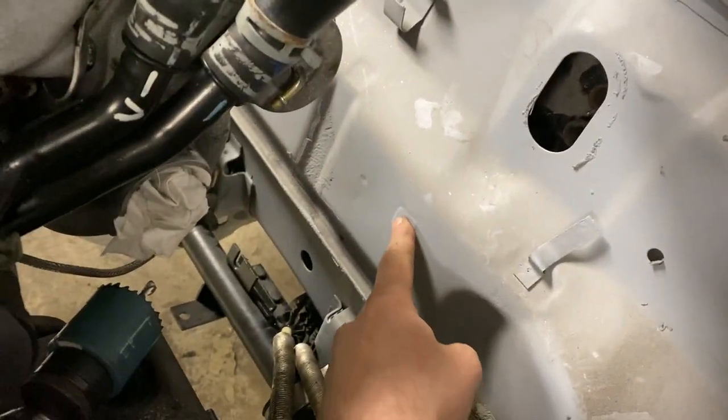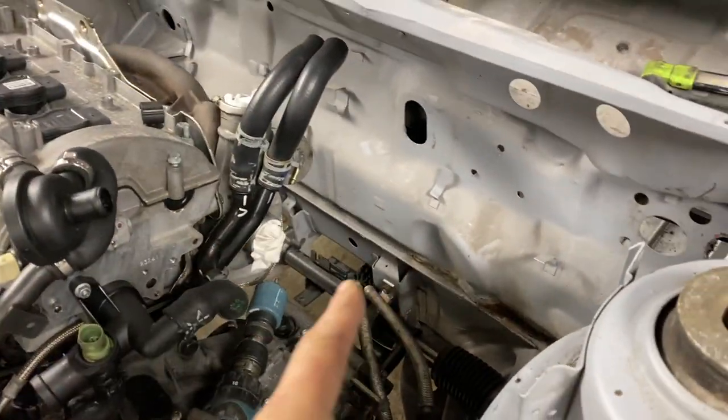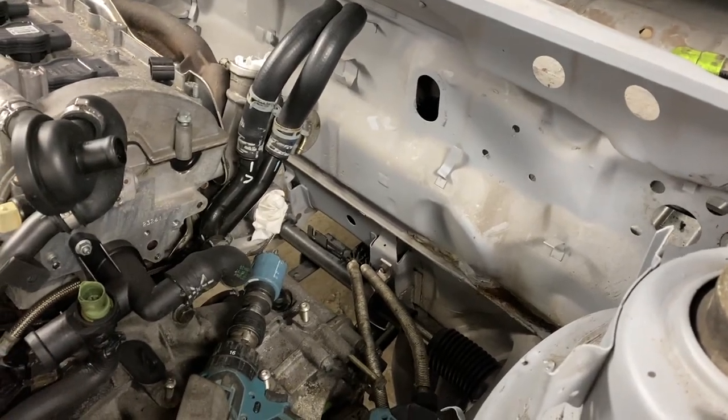That little indent there is that cable clip, if you see it on the bulkhead there. So we don't need to worry about getting rid of that. We're going to drill directly where that is because it's nice and clear with the heater box and everything, and it's a nice area. So drill's in there, let's drill the hole there, then we start pulling the loom through.